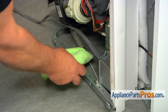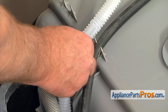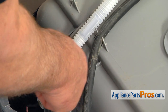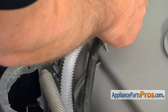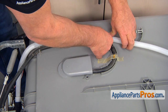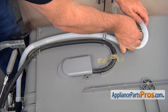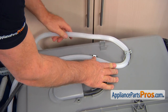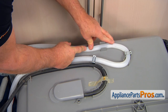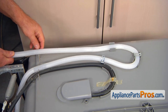Now we can remove the towel. We're going to route the drain hose into the clamps — place the drain hose in this first clamp here. Make sure the hose is not touching any edges, so it's free. Then continue going up, placing the hose under this first metal clamp, and loop it. Place it under the second clamp here — perfect loop. Turn it and place it in this clamp, then go down to the last one here.